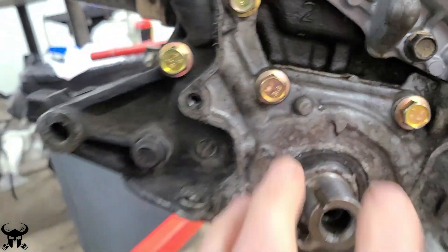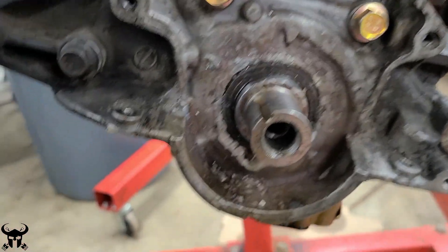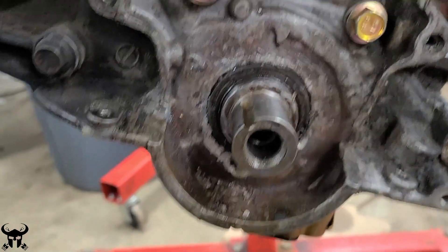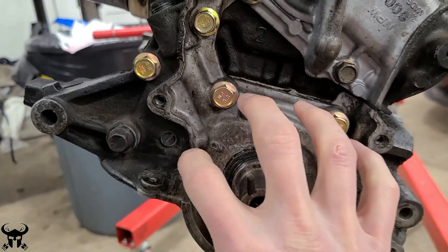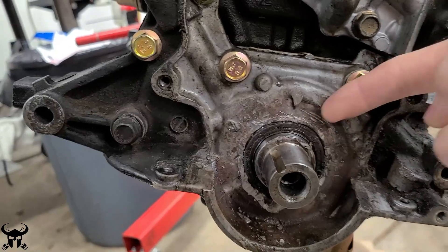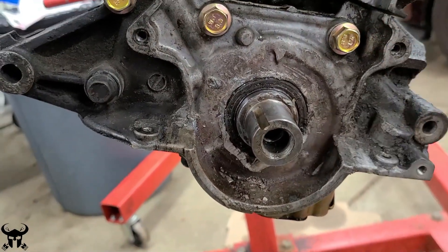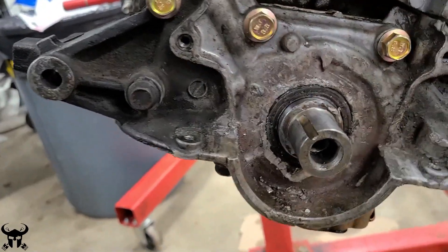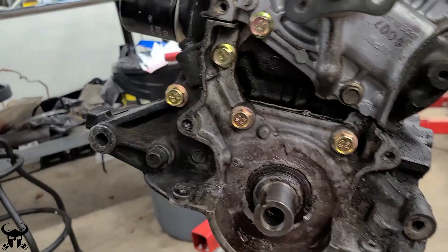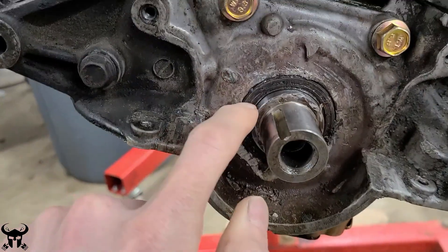This gear was so difficult to get off — it's really close to this oil pump. If you are doing your timing belt, don't ever touch this unless the seal is weeping oil. It's not even worth trying to get this gear off. Mine was nearly impossible — not because of anything up here, this was just corroded and it would not come off. I ended up having to get a bunch of different chisels around the back side. You can't get a puller around it because it's too close to the oil pump, so I used chisels stepping up the side, making sure I was staying close to the thicker portions where there was steel behind it. I stepped up to bigger chisel sizes with an air hammer, switched to a pointy style air hammer and was able to hit from the back side and the gear popped off — but it was a very destructive way of getting that gear off. I highly recommend not doing that and just leaving this front seal if you do your timing belt.